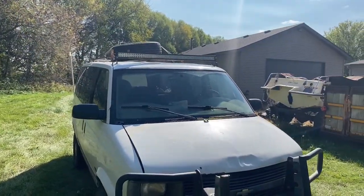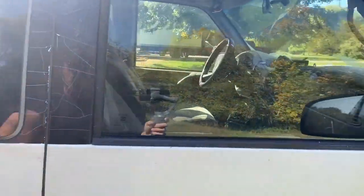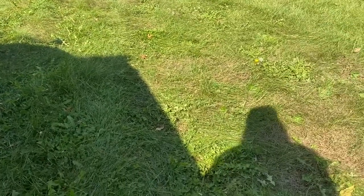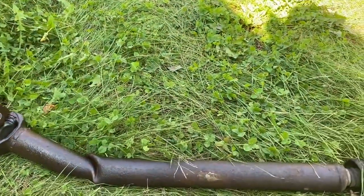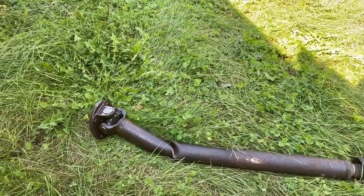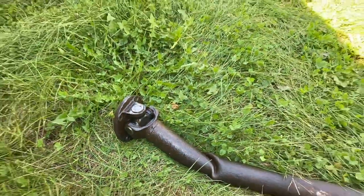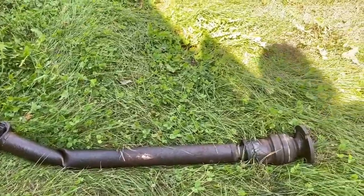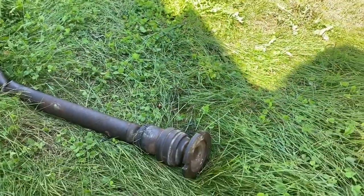Other mods: a light bar on the front — very useful since the headlights are very useless. The front drive shaft needed to adapt the full-size transfer case to the Astro front differential. I cut two inches out of the drive shaft and then stick-welded it back together in a parking lot. This drive shaft has definitely seen better days, but it did last 4,000 miles. On this end, we adjusted the flange slightly to accommodate the larger bolt circle on the transfer case.